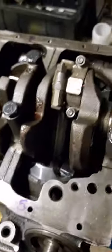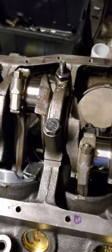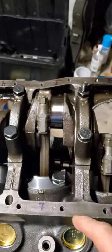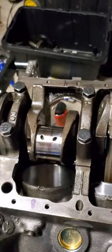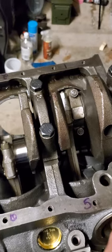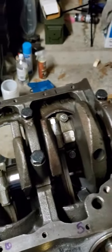It should not be very difficult to turn this motor over - it should be fairly simple. What I do is every time I install a piston and torque down the connecting rod, I give it a few turns to make sure it's not binding, then go to the next one. That way you're not trying to figure out which one's binding later on. This did happen to me - I had one flipped around on number one. It felt great with just number one there, but as soon as I put number five next to it, I couldn't turn it.